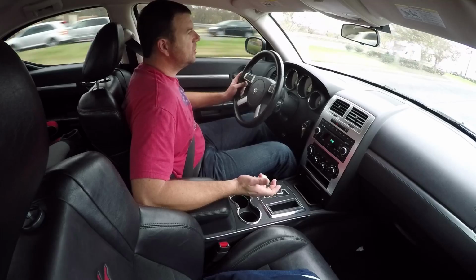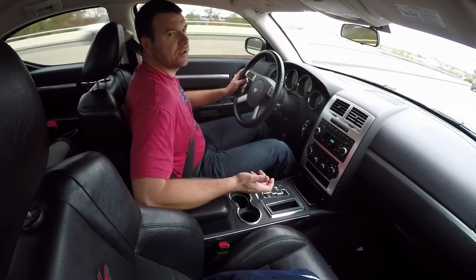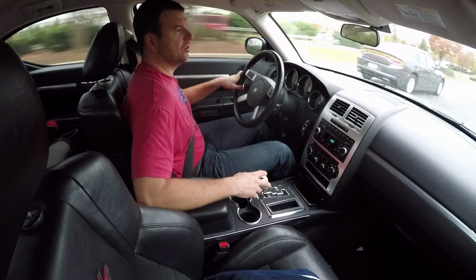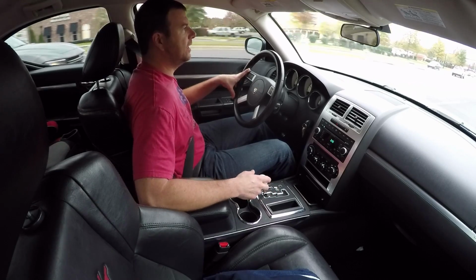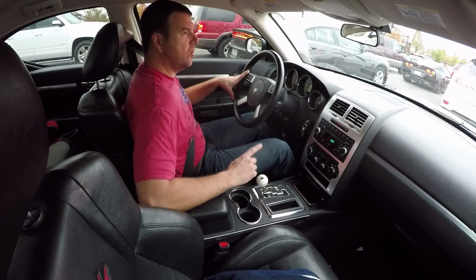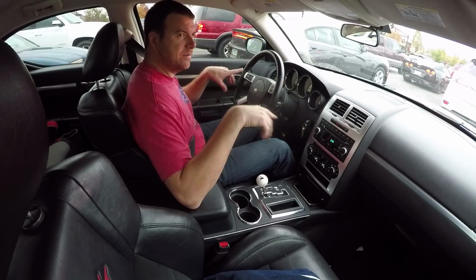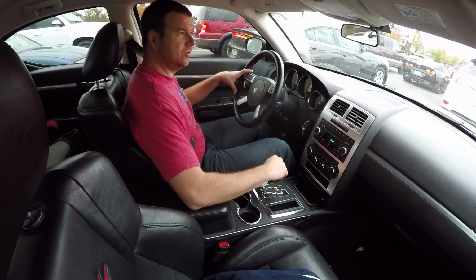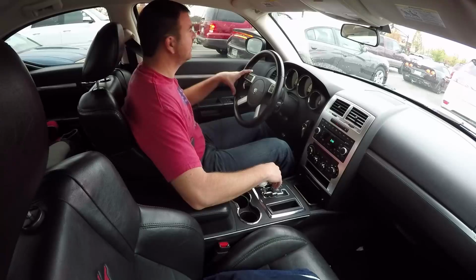bolts was ridiculous. You do have to jack your engine up. You take the engine mount out, jack it up or down at various times to reach certain bolts. You're trying different angles. The last thing you want to do is strip out a bolt because you don't want to take the time to get a good angle on it. So I think it's like 18 foot-pounds for the exhaust manifold bolts. 18 foot-pounds is not a lot. They're aluminum heads. The key to it is go in a pattern starting from the middle out on each side, and then go back a couple times and just make sure that they're tight enough, but do not over tighten them. I mean, you do not want to strip out a bolt in your aluminum heads.